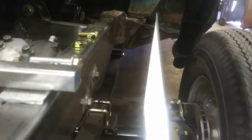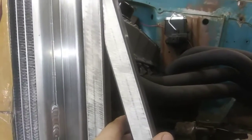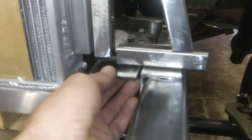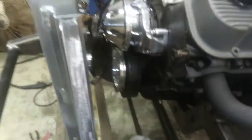So then I made these with about a 76-degree cut on there — look at that. I angled that bottom and it'll go on there like that. Had it all mocked up — kind of hard to hold with one hand and show you guys. Then I made these little plates, 3/16ths, rounded the edges, and I'll put that right underneath there to give it some more welding surface. I think it's going to be pretty stout — I don't think I'll need the braces coming back from here down to the frame. I think it'll be strong enough.